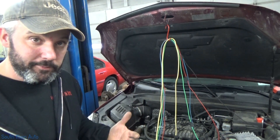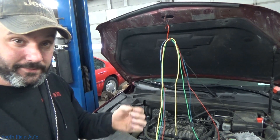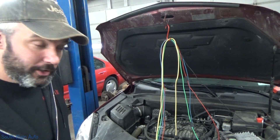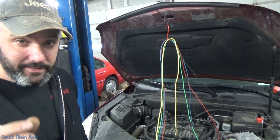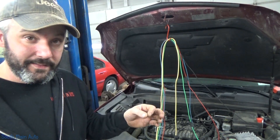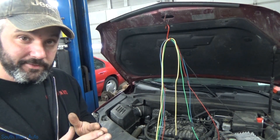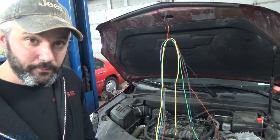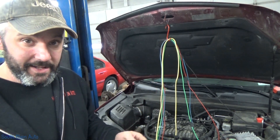On this particular car, you probably could have loaded up the parts cannon and said it needs all these parts and you'd have been right. But what happens if you get in there and find out the crankshaft has moved? I was just at my brother's shop and they had a truck setting a lost RPM signal above 2,000 RPM — it actually had a crack in the cam gear reluctor wheel. Centrifugally it would start to open up above 2,000 RPM, but when you barred that engine over and visually inspected it, everything looked spot on. Watch it on a scope and suddenly you see this extra timing mark. In that case there is no way to figure that out without a scope.